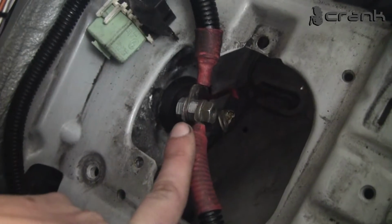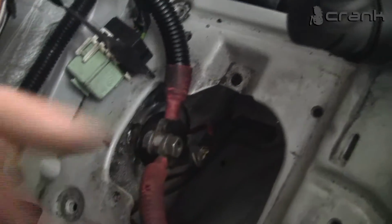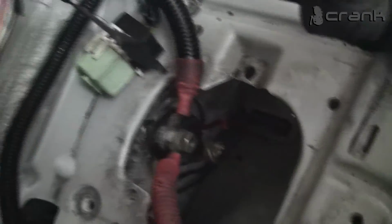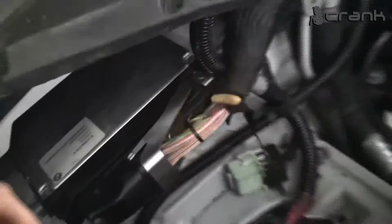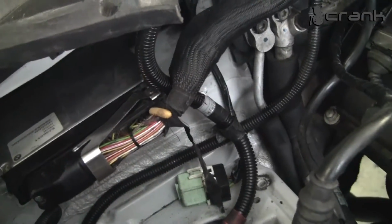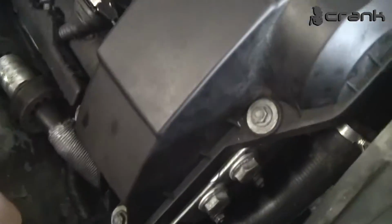We're going to make a video about the EWS wiring, how we install it. We didn't bypass it, we want to use the original EWS 3, so I'm going to make a video about that. How the wiring for the automatic is removed, and we only need to install a multiplug for the reverse gear. This is not a big job. So these are the main things you should do for this transplantation from 4-cylinder to 6-cylinder E36.